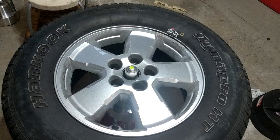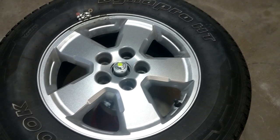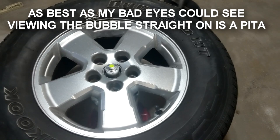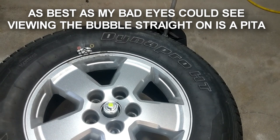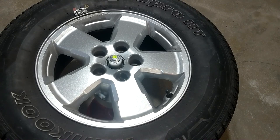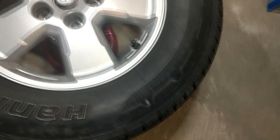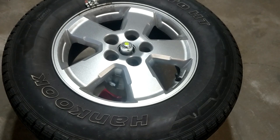So here's the comparison: the hardened steel pin not filed down, but the aluminum hole it sits in has been drilled wider. I've got it dead-nuts centered with two weights over there, one on each side of the rim since they're even weights. This tire previously had easily three times more weights. I touch the tire just slightly and it rocks for a while — that's the modified balancer working well.